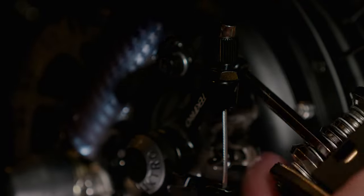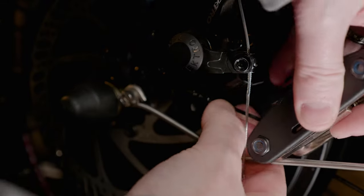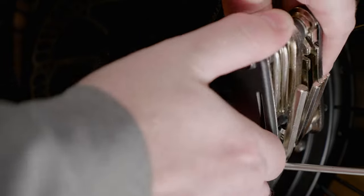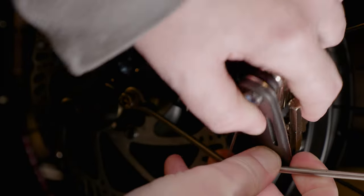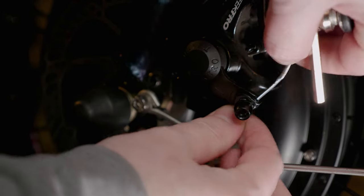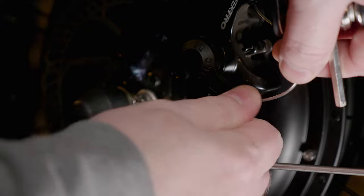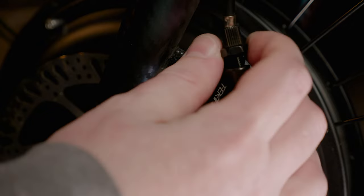And now that we're done with the rear calipers, it's basically the exact same process for the front, so we're going to go ahead and start doing that. Basically just loosen the back two bolts as I'm doing in the video, and then you'll remove the brake cable by twisting the existing hardware out, pulling the cable out of the attachment there, and then unscrewing the adjustment screw all the way and pulling the cable through like we did on the rear.